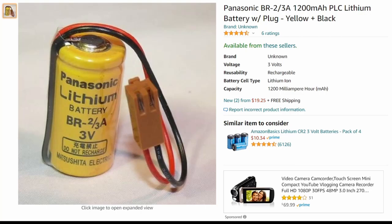And here, of course, is the more conventional source for people that don't have a bunch of Model 30 risers around like I do. But it's important to note, if you get, for instance, something like is pictured here, that 2-pin header is different. It's bigger than what the L40 needs. And, of course, you can make your own harness out of the old lead and maybe make a little 2-pin connector that's insulated, won't short out anything, and makes it easier to connect up that battery, which is a little bit of a challenge, as I'll show here in a moment.